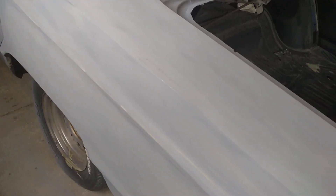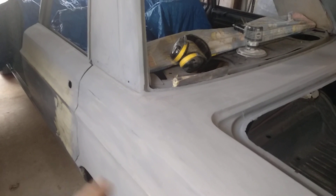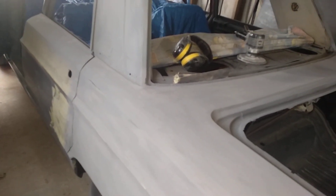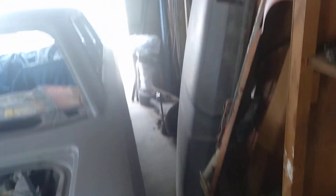I did the same with the back guard - I blew some primer on it. I didn't panic so much about down the bottom because I haven't really finished filling that. Same with the tops of the doors and tops of the guards, I blew some primer on there, but I didn't worry about down the bottom because that needs more primer and more filling. So the tops of the guards are sort of half finished, and the tops of the doors as well.